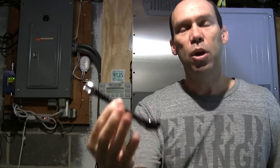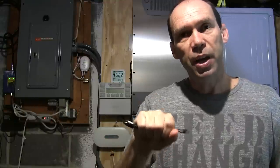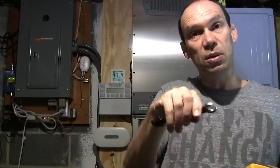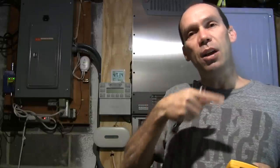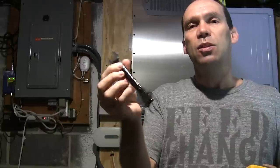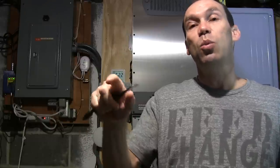There are certain rules: first, try and insulate the spanner you're working with. Second, connect your red positive connection first. Here's the logic: if you've already connected your black negative cable, that potentially creates an earth point to the case. If you haven't connected it yet and you're doing up the positive first and accidentally touch the case, you won't have a continuous circuit. When you then do the negative black line next, if you accidentally touch the case you're at the same potential. So always do the red positive connection first, then connect the black. And when disconnecting, disconnect the negative black first, then the positive.